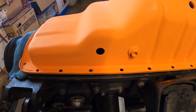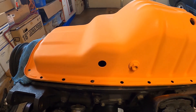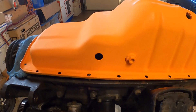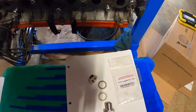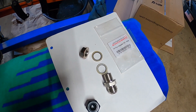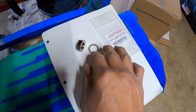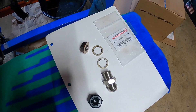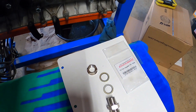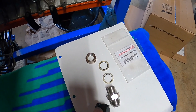For the fitting I'm going to be using, the oil drain is going to be a dash 10 AN fitting and it's going to be a bulkhead type connector. I got that from Amazon — this is a Kinugawa oil pan adapter kit, dash 10 AN. It comes with a bulkhead adapter, two washers with a rubber seal on the inside diameter, and of course the nut. Since I won't be doing my turbo conversion right away, I went ahead and got a cap for the AN fitting.